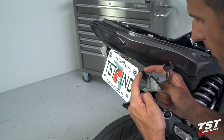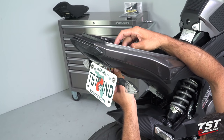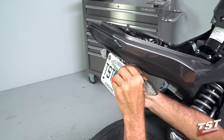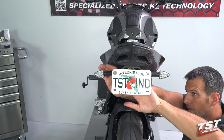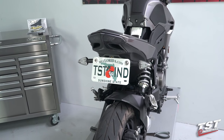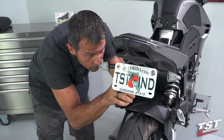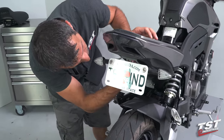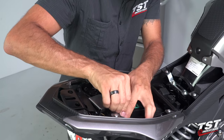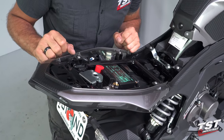I've got a little bit of mushrooming here by the base, so we're good there. This is solid. At this point, I'm just going to tighten up the wires that are fed through my zip ties and make sure that they're routed nicely, then lock down on the zip ties. I'm going to cut the excess off, making sure I don't damage any of the wiring. And lastly, on the inside here, I'm just going to make sure that I don't have my wires dangling all over the place. I'm going to tighten them up and route them tightly and away from any pinch points.